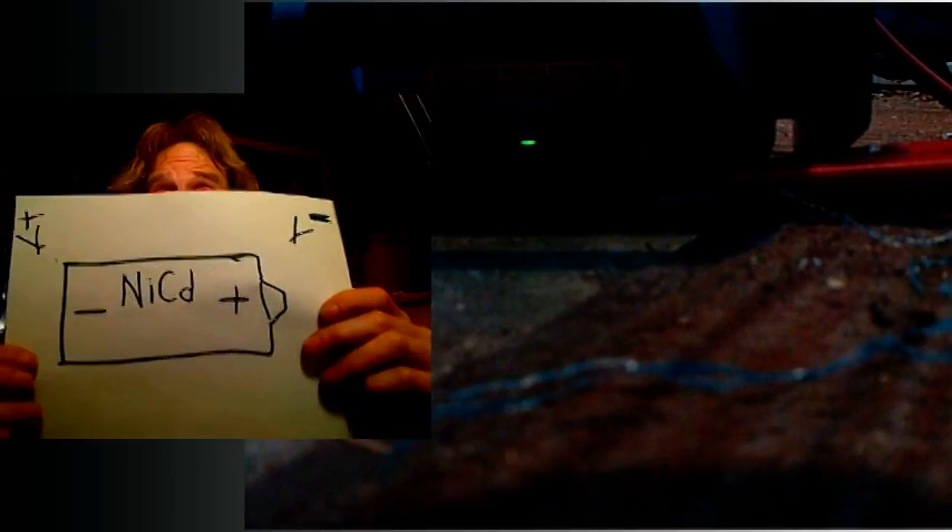What you do is basically take a strong amp source. I'm using a battery booster — a backup you hook onto your battery to give a little more amps to start your car. It's 12 volts with 300 amps if need be. You basically zap the battery opposite its polarity, running electricity through it backwards in really short little bursts.